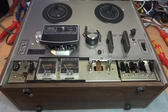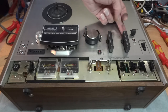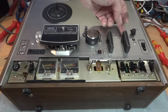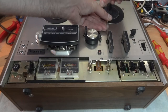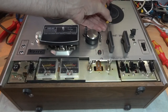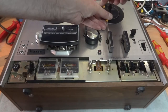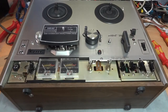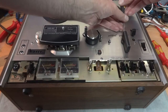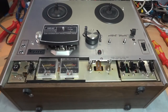Now we're going to take this silver front off. We'll do the knobs first - there's a little screw at the top of each knob inside. That's the play and record knob, and that's the fast forward and rewind. Just angle your screwdriver in there, find that screw, and undo it a couple of turns - don't want the screw to come out completely - and the knob will lift off.